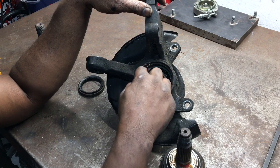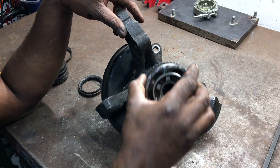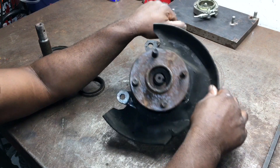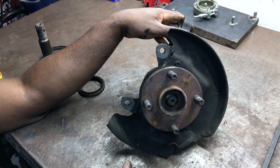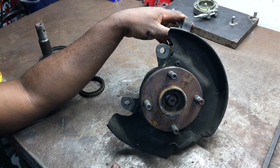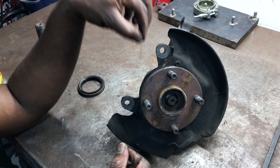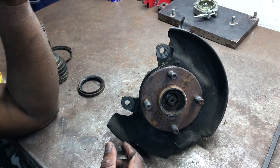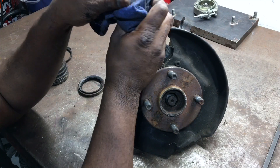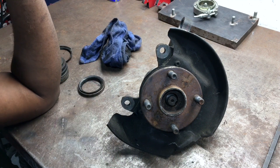It's only a little bit of grinding you have to do. Once we get the clearance we need, the axle will sit further down and we'll probably get a few more threads - and we're good to go. That's what you have to do to the FX16 to get it to accept the Honda axles. I'm pretty sure this should work on earlier models too, 1992 and up. If anybody out there wants to do a case swap on the AE92 or even the FX16, this is what you have to do.